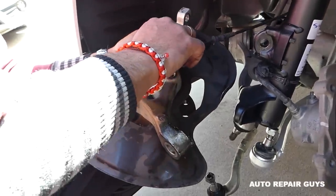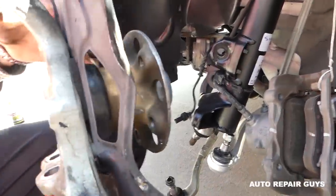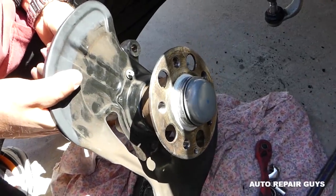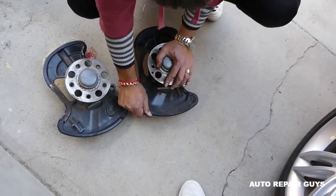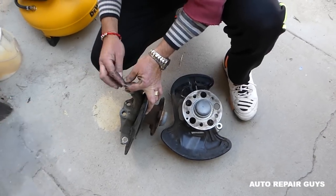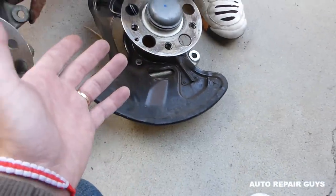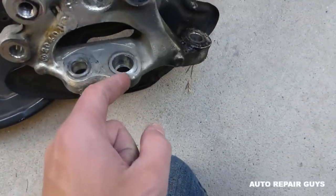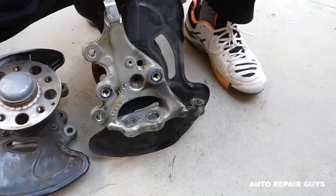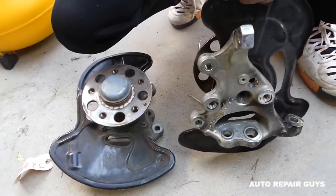Pull the sensor out. It's good to always clean the sensor before you reinstall it because brake dust can trigger an ABS light in the future. This is the spindle - this is how you remove it. Put everything back together in reverse. Make sure that metal plate is straight so it doesn't touch the rotor and cause noise when moving. Here you can see where ours was damaged from the impact - it's stretched a little bit in this direction and that caused the camber problem. We'll replace it with a new one. Thanks for watching, please subscribe, many more videos to come.